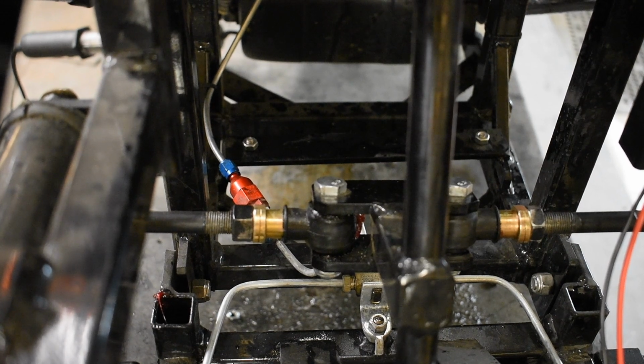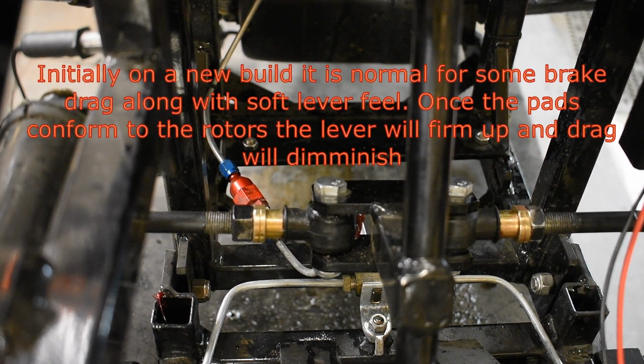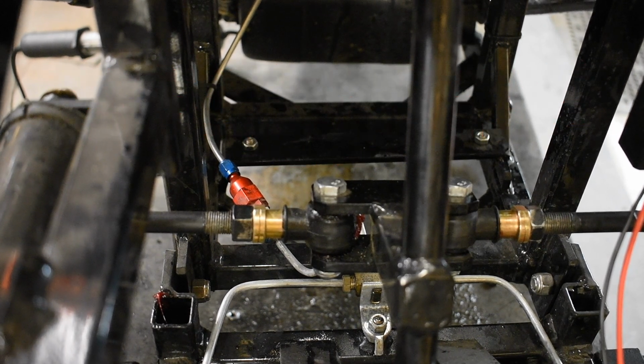If there's not enough back pressure, you don't have enough lever to really make the brakes work properly, so you have to pump the brakes, which is what we don't want. If there's too much, the brakes will drag. So there's kind of a fine line between getting this set correctly, and most of my testing when I take it out for the final test drive is related to the brakes. The brake pads have to be seated in, otherwise they don't contact the disc properly. So there's a wear-in process, and once in a while I run into these valves that have to be replaced and retuned and that kind of thing.